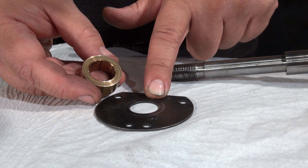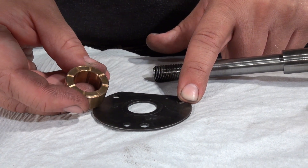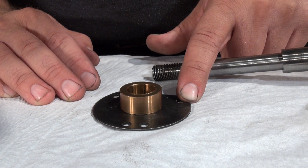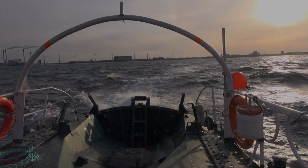We're going to figure out how to solve this. One possible solution is to carefully polish this section so there are no burrs or edges, and then simply turn the bushing around using the other side — which is symmetric — up against the plate. That should re-establish the oil flow and keep it from contact rubbing again. I'm going to take all these parts from both turbochargers to another workshop with very big ultrasonic cleaners, give it a thorough clean, add some pre-lubrication oil, and put them back together under very clean circumstances. That should give us two fully functional and serviced turbos for Vostok in a pretty short time.